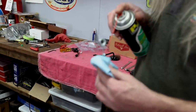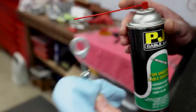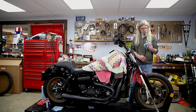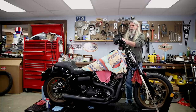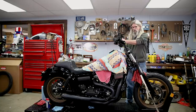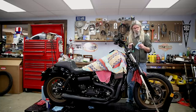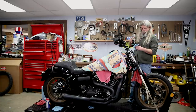When I was doing a service on someone's motorcycle and their cable was very stiff, I would take it off, disadjust it, hang it up, and during the course of the service I'd go by and lube it. I'd do some other jobs, put some air in the tires, change the oil, then lube it some more. By the end of my service I was pretty confident the cable had a good amount of lube. If you've got an older bike and you haven't lubed your cables in a while, you will definitely notice the difference in the way your clutch operates when you lube your cable. New or old — lube your cables.